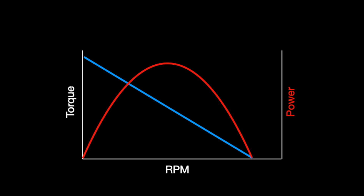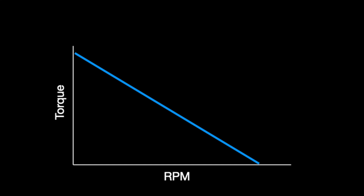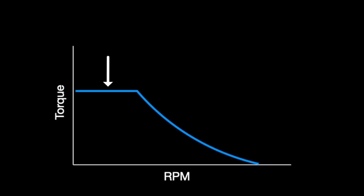The first big reason is they want to keep the motor light. When we look at a typical motor and its torque and power curves, maximum power does not occur until RPM increases significantly — that is the RPM you want to be in when using the motor, not where the torque is highest at low RPM. However, max torque dictates how robust and heavy the motor needs to be. So the motor controller reduces torque at low RPM by limiting the current in that range, which helps the rider control the bike and helps the manufacturer keep the motor lightweight.